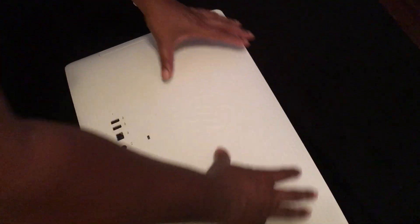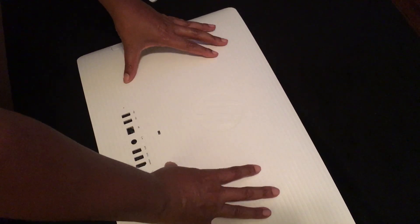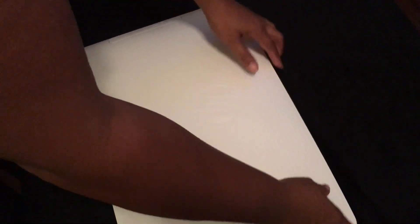You want to take off the cover, which is the back of your all-in-one, and pry the back from the front. There are grooves in it — you'll see where you separate it. There's a little gap when you first open it. Pry the top part first, then the left side, and once you've got that left side open, go to the right side — that's how you properly separate the cover from the front of the computer.